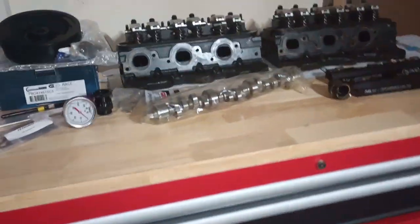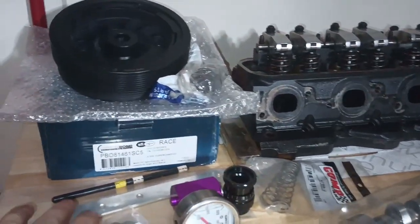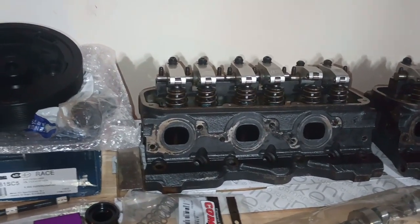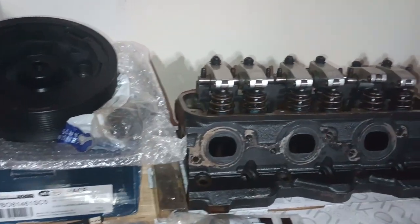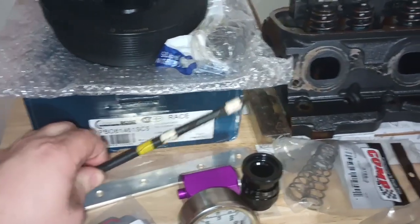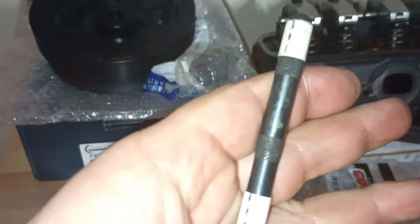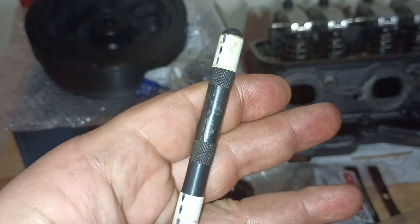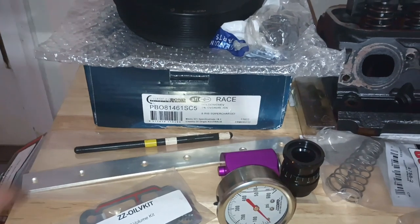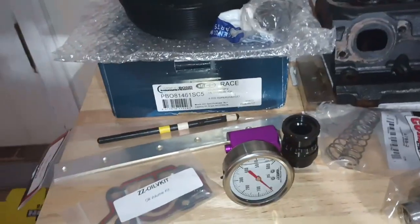That's all I've got for today — actually it's quite a lot. We're going to get used to figuring out how to put all the valve train geometry together; this is kind of above the average bear's amount of adjustment we have to work through. I have a few more parts and pieces to pick up to complete this valve train, and then we're going to be doing some measuring. I just set out my push rod adjuster here — I put some extra markings on there so it's easier to see than what they provide, which is just those little dashed lines; those are a pain, so I'll rely on a little brighter lines. Got an oil volume kit — obviously you want to do something along those lines on every build.